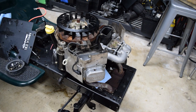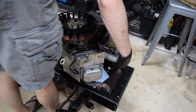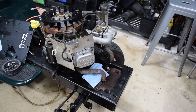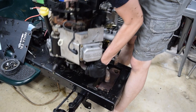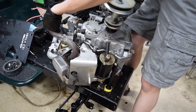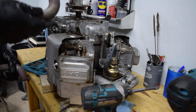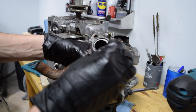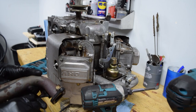Last bolt and then this engine is free. Let me just see if I can liberate it. This is going to be interesting because I am weak and this engine is not small. I'm not going to reuse those gaskets — there's no reason to. This one's not even the right gasket: it has this kind of gasket which is a little too small. And this one had a different gasket. So at some point someone pulled these exhaust manifolds off and did it cheaply, using random bits of hardware and the wrong gaskets.